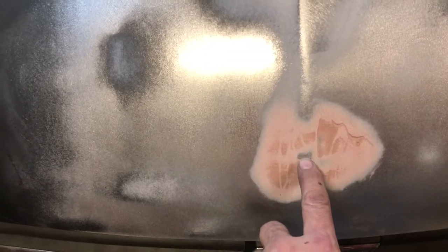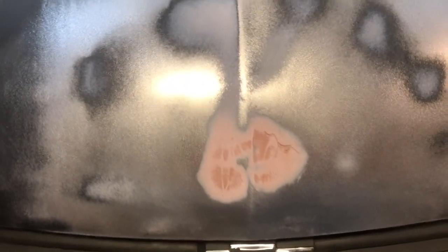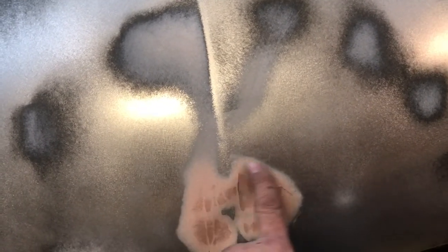You can see that there was a little high spot right there, so we get this all evened up, sanded down again, till it's like just one smooth surface that looks, you know, kind of like this with, you know, a nice ghosting pattern around it, so that it'll be a real seamless transition.